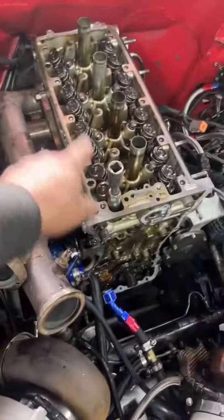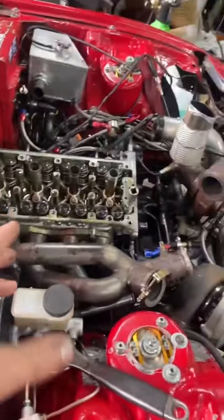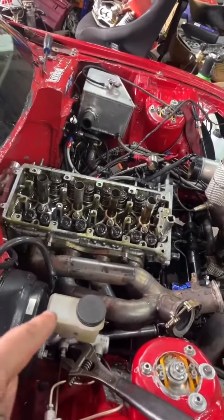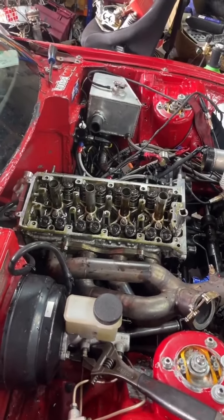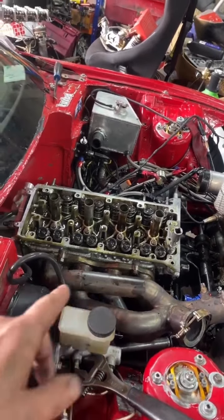So now I'm just going to go and take off these studs. These are big heavy duty studs - they're Inline Pro studs, thick 11 mil shank things. They actually are beasts, but now they're just not strong enough for what I'm doing with this thing. Because when you start pushing this big power, we are stretching them now, stretching the thread. So we are going to upgrade these to 625s. Now these are - I just use a 16 mil bolt on these, but for you Americans it'll be like... just need to put that one out your drawer.